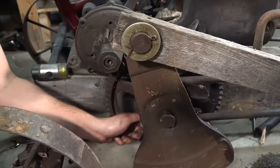Now finally with the sawing arm off, I'm hoping to get the red flywheel and crankshaft off. Here we have the clutch removed and behind it is the safety clutch — that stops the saw from moving but allows the engine to keep turning. So if the saw binds in a log, the whole saw wouldn't explode. You can also see where the crankshaft rides on the Babbitt bearings — they're at a 45-degree angle to the piston instead of perpendicular, which was apparently advertised as helping absorb impact better.